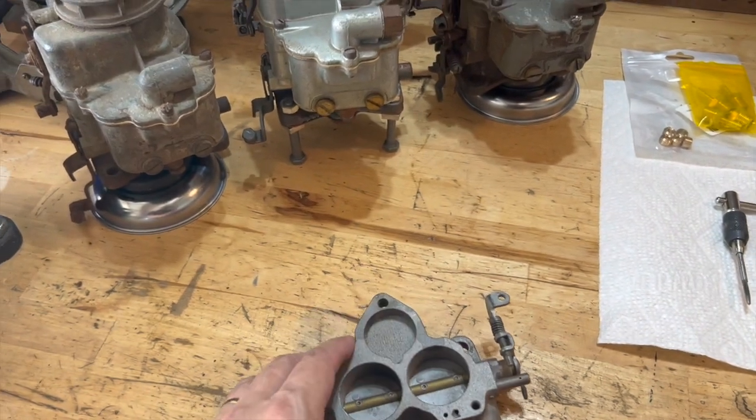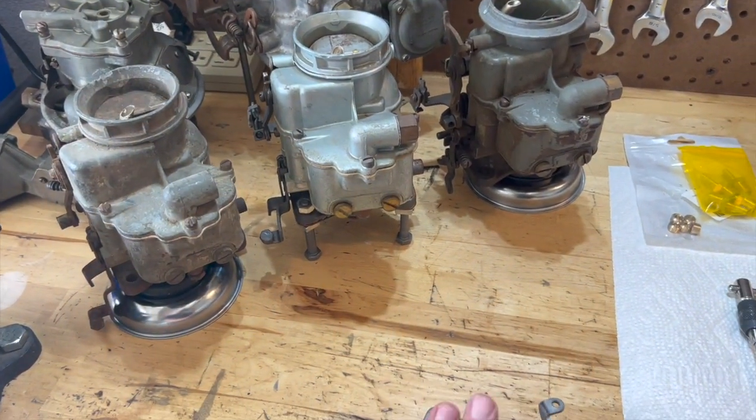You can tell that one of these air horns on top is the air horn for a truck — it's a little different air cleaner, so watch out for that. There are some differences among the years 54, 55, and 56 with CFM. It's best if you can get a matched set of three Holley 94s that are the same, or at least keep your middle carb on your three-deuce setup separate from the other two, with the end two matching each other in CFM. If you want to use three deuces and take that middle carb and give it the right vacuum signal for a 57 to 64 or an aftermarket distributor with both vacuum and mechanical advance, you want to make sure that signal is correct.